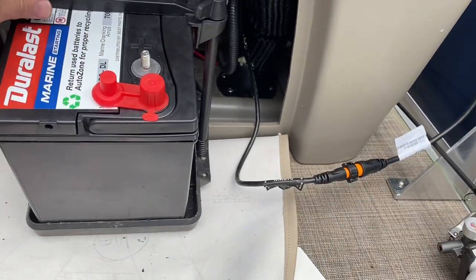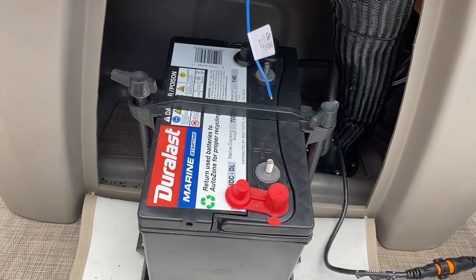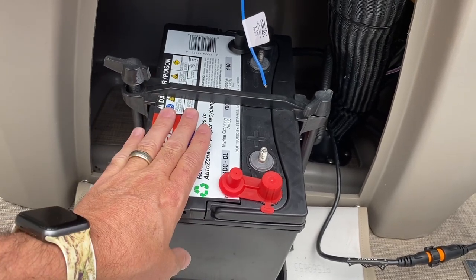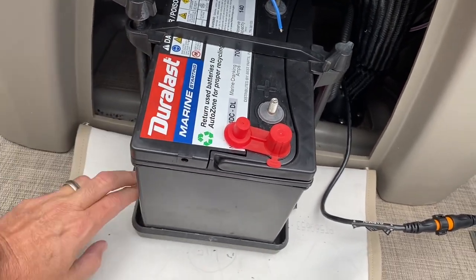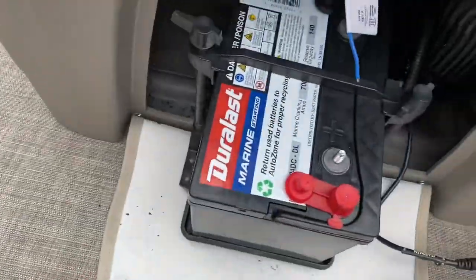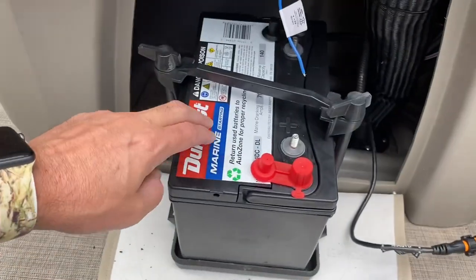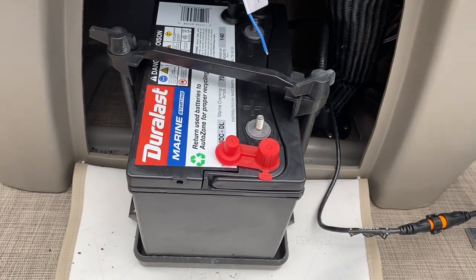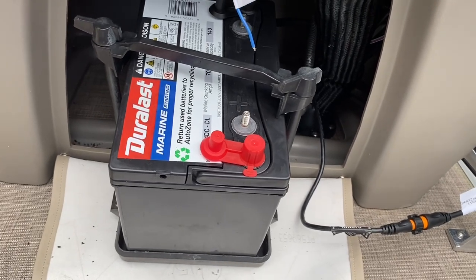What I'm going to do is install a new deep cycle marine battery. I will be getting a 24-volt trolling motor, so we'll have to have two batteries. If you get two of the 24s, they'll fit under here pretty good. I'm going to screw the case into the floor back there, put the battery in, tighten it down, and run the trolling motor and the fish finder to this battery. I didn't want to run my fish finder to the cranking battery because it will be on for a lot longer when the engine isn't running — I didn't want to kill my cranking battery.